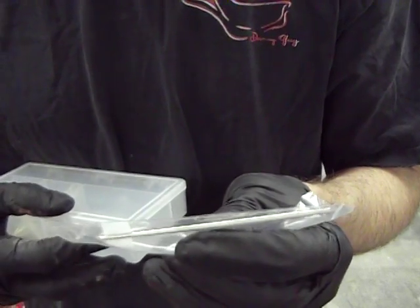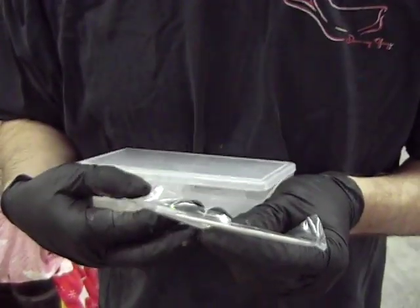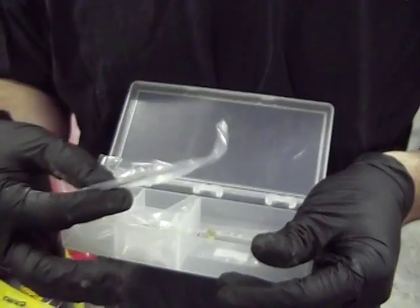Now there's different manufacturers, different needle combinations. The reason I use the Dynojet kit is because they've got dyno graphs with this particular bike showing the horsepower increase, and they claim about 5% increase when you use their jetting and their needle combinations.